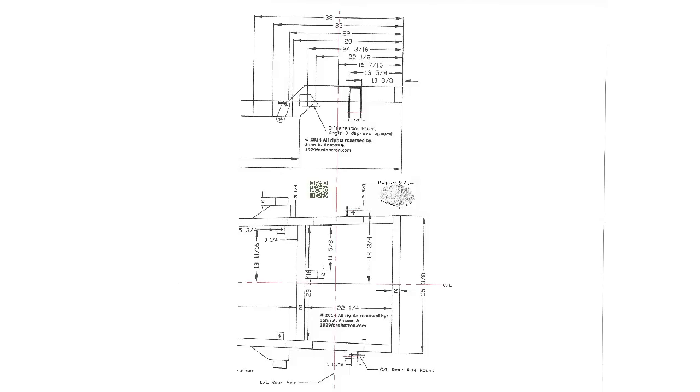When you compare this chassis design to the original Model A frame, you'll notice that the only thing the same is the wheelbase. I narrowed the front of the chassis to facilitate the Corvette suspension and narrowed the rear of the chassis so that the body would fit onto my chassis a little wee bit better.